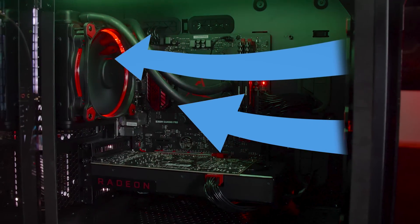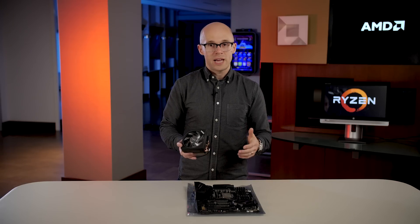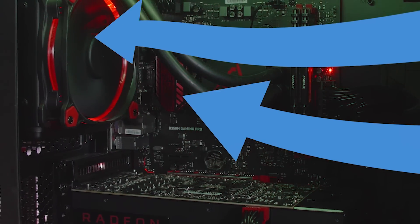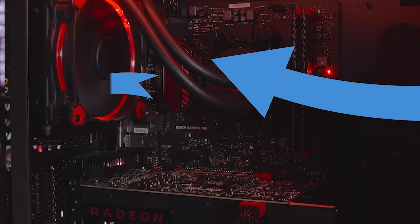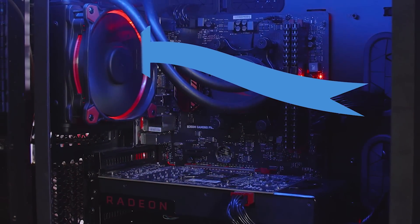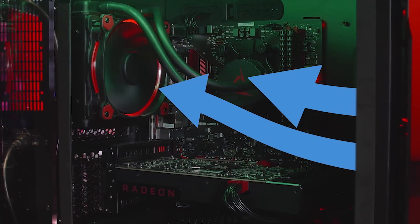The last thing you'll want to keep in mind is effective cooling in your PC. It is not enough to have one fan in your computer case — you'll want to have a few. Generally, people intake air through the front of the case and exhaust air out the back, but some enthusiast PC chassis take air in through the front and exhaust out the top. The point is you want effective airflow so there are no dead zones that collect heat, make your processor run hotter, add noise, and subtract performance.